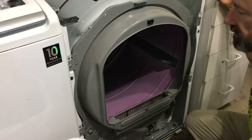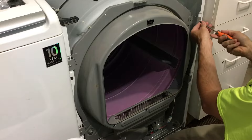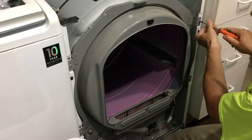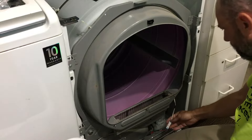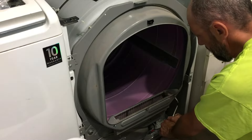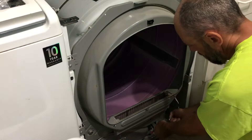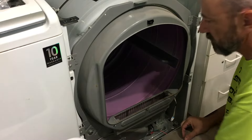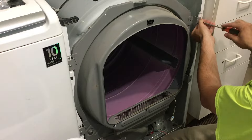You can see the belt move and the pulley is toast. So our dryer that we thought was running just great actually isn't. Good thing we got the replacement parts — super happy that we got all of them, especially for the fairly inexpensive $100 price. Next up for us is to remove this front drum retainer. This sensor is connected to the front of the part we're removing — it has a push-and-pull clip, push the little button and pull it out — that releases one of the sensors we'll be replacing. We'll undo these four screws and pull the drum out.